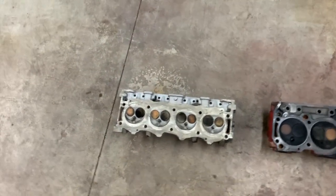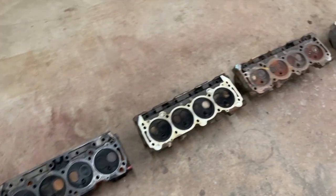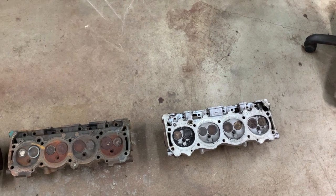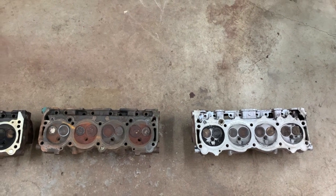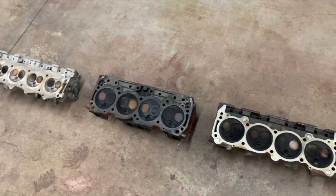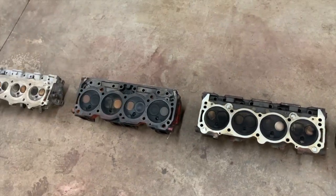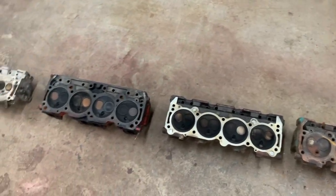That's really all I have for you today. I'm going to CC these up for the next video. Then we can have an idea of which one is the best and most ideal chamber size for compression, and which one has the biggest valves. I'm going to tell you right now, the 350 Buick probably has the same size. This is a 69 350 Buick. It has a smaller valve head than the later ones. The later ones had a bigger exhaust valve, but it should be about the same size as the 66, 67 300 head. That's all I got for you today.